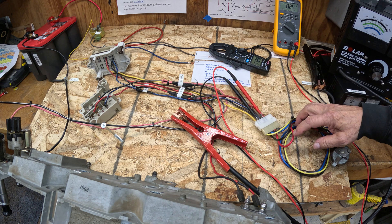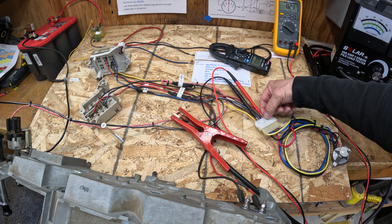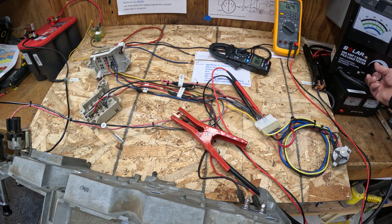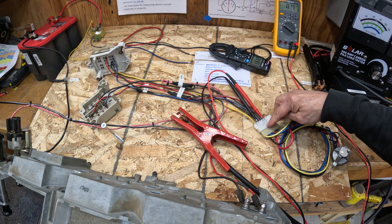Just as a review, the switch is powered from splice 1 on the red wire, and all these other switched loads are provided power through that. We've got about 13 amps running through the accessory circuit now — I had to drop it down a bit, I don't want to fry the switch. The battery tester isn't real precise on this, as we discussed in other videos. The voltage drop through the switch and terminals is now reading 0.18 volts.